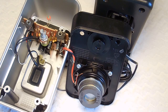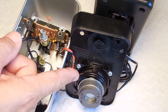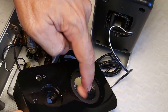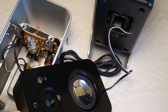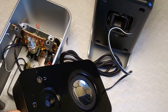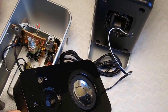In the event you have no idea which is positive and which is negative when the wire is coming out of the wall to connect to your sound system, the easy way to do it — you're going to take the wires going to the speaker and have somebody watch what the cone does on the speaker. This is the cone right here. When it's properly connected with the positive in the right position, the cone will push outward. When it's in the wrong position, the cone will go inward.